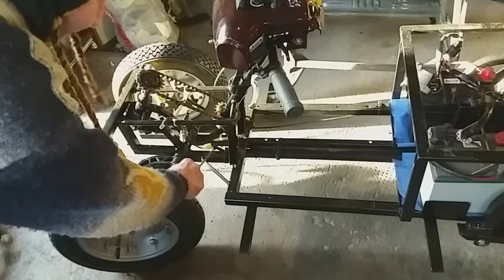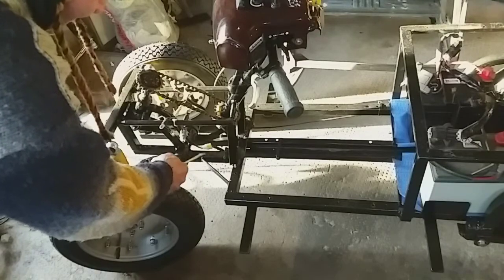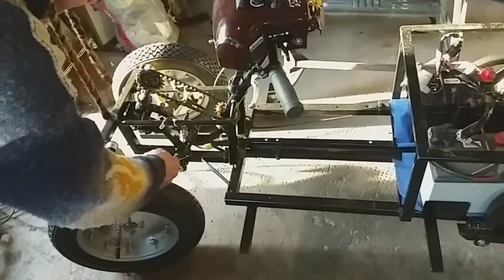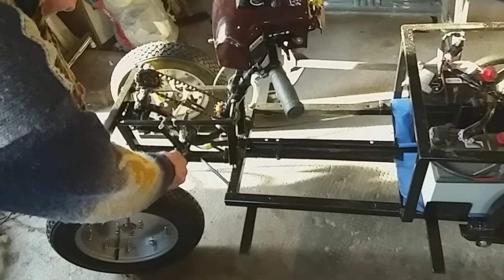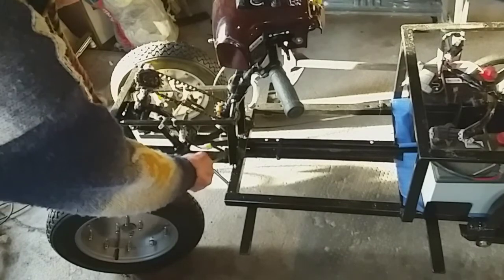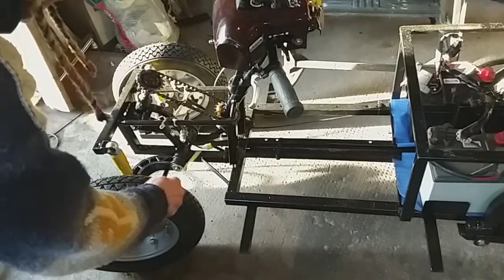I've sleeved this as well, so the bit of tubing - I've got 30mm square section - I've banged over the other, it's folded up, banged it over, so it's double welded. It was already welded each end anyway like it is on the standard chassis, but now that's made it longer.